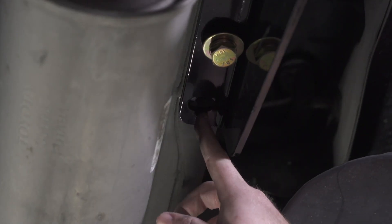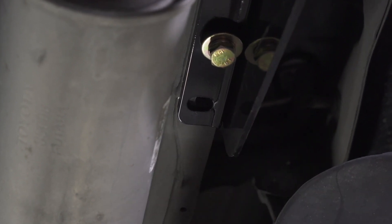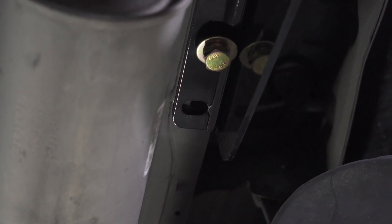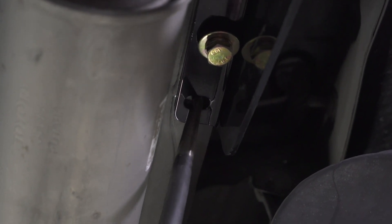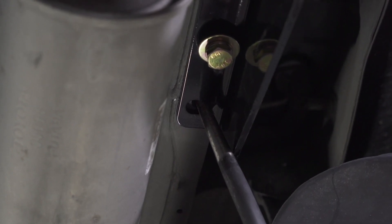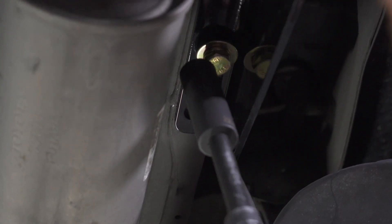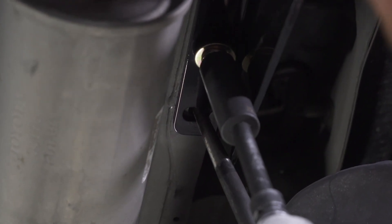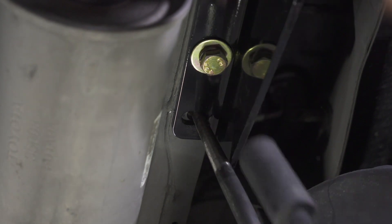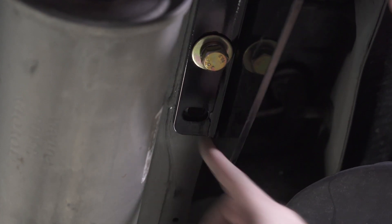Our last attachment point is just slightly off — we need a little bit more room to the outside to put our bolt into place. Here's a tip: if it's just slightly off, take a pry bar, put it into that hole, and pull outward. You can see the hitch move over to give us a little more space. Now take a 22 millimeter socket and tighten this bolt while pulling outward on the pry bar. Once that's tightened, let go of the pry bar — now the bolt is holding it in place with more room.